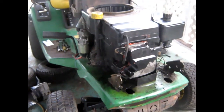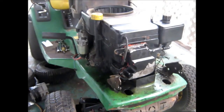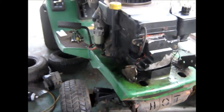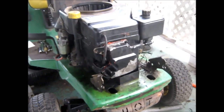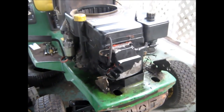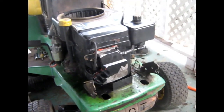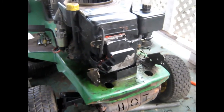She's working now. I still need to sort out the safety switch — you can't start it with the starter switch, you have to tweak it down here with a pair of pliers off the starter. The starter is still holding in there with that shim, and the motor is running all right. It's just noisy, but I didn't put an exhaust gasket in there, so that may be part of the trouble.